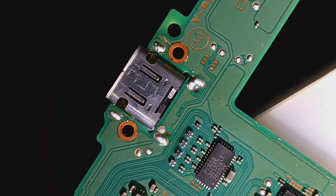Welcome back. This is part two of two. We have a B2B Nintendo Switch that had error code 2101 — we got rid of it by replacing the M92, but now it's having charging issues. Upon visual inspection we noticed that the charge port is jacked, so we're going to go ahead and get it off. Already got it prepped — going to get it off and replaced and get these folks back to gaming.